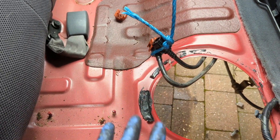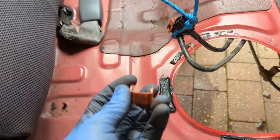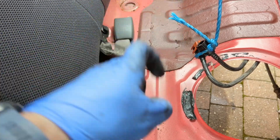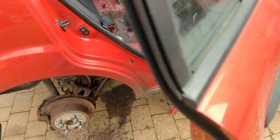I've tied the fuel lines up out of the way to try and stop any diesel from dripping over the car. Remember to give the handle a clean before putting it together again. The clips on those — the orange clip pulls up, and then inside you've got two tabs each side, which is quite difficult to get good grip on.